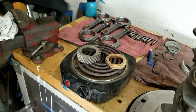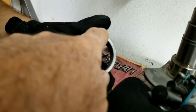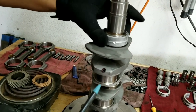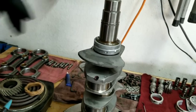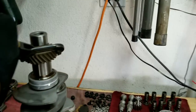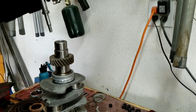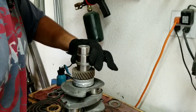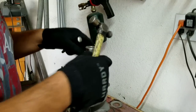We've got our bearings marked — you can see the little marks there. We didn't have our paint markers, but you can just scribe it in there carefully so it goes down in the right direction. If you get that upside down it's a pain — you've got to pull your gears back off. Then go ahead and set the gears on one at a time, dots facing up.